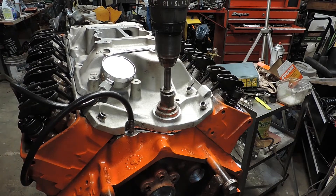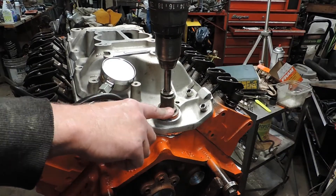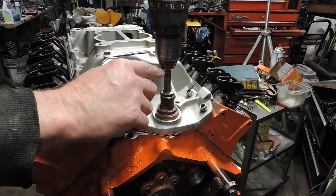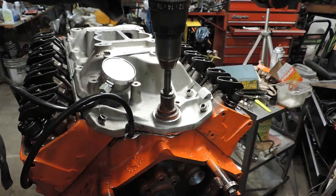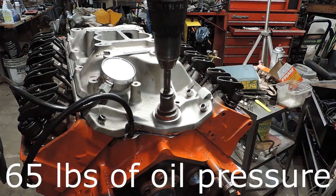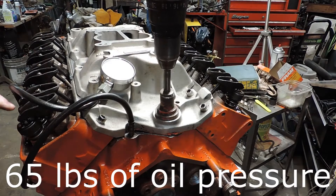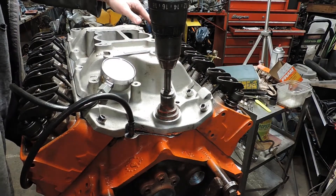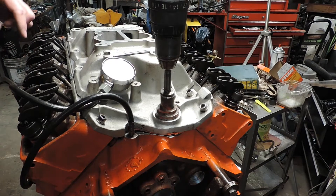I stepped ahead here because this is getting to be a pain to work with. I built myself a custom oil pump driver, which I need to rework, but the main thing is making sure I'm getting oil up to all of the rockers. We're running about 65 pounds of pressure. This one's got oil, this one's got oil, this one's got oil — but I've got four or five at the front that aren't getting oil yet.